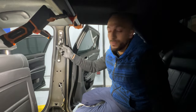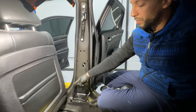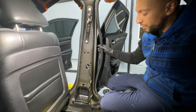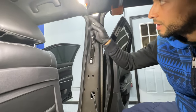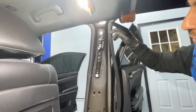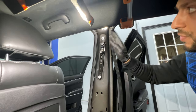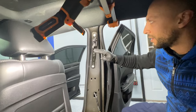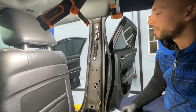That was a 14-millimeter nut up top. To recap: first we disconnected the battery, removed the T50 bolt on the seat, removed the door trim on both sides, removed the weatherstrip, released two clamps on each side, and removed one T20 Torx screw at the top — accessed by pushing the headliner. The headliner returned to its original shape with no cracks. Honestly, this design is not great — most cars have a plastic cover hiding the pillar screw, but the Chrysler hides it behind the headliner.